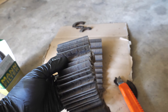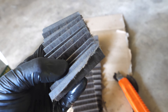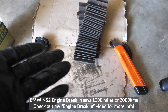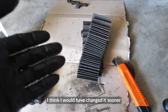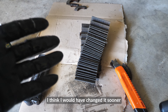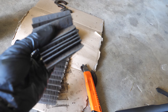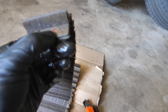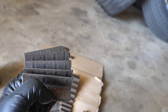It's everywhere. Should you change your oil within the manufacturer's recommended specifications? For a BMW, after a rebuild it was like 1,200 miles or something like that. Should you change your oil? I would say yes — there's a lot of gunk and dirt and stuff that's still in there from the manufacturing process. Even from my rebuild, there seems to be a lot of crud in here, a little bit of silicone. I think you should definitely change your oil sooner.